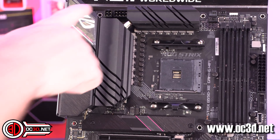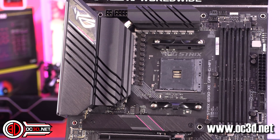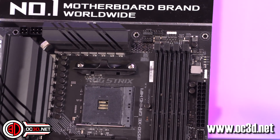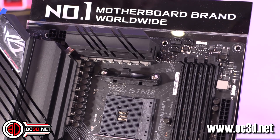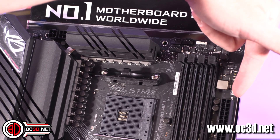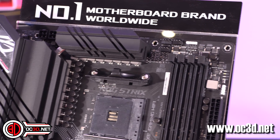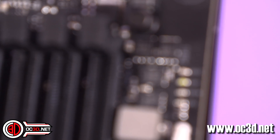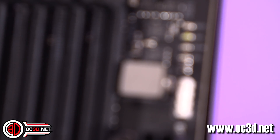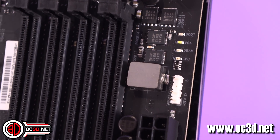Top left-hand corner, you have an 8-pin and a 4-pin for power. You only have to connect to the 8-pin. The 4-pin is for additional power if you're really spanking the overclocks and running into power issues. You can see three fan headers up here — one's for the CPU, then a normal one, and an AIO one. There's also a 4-pin RGB header and a 3-pin addressable RGB header. There are also four little lights down the side — that's your POST code readout — showing Boot, VGA, DRAM.